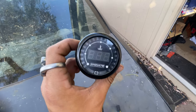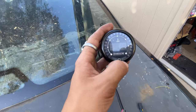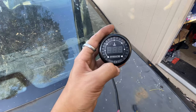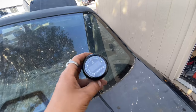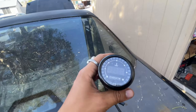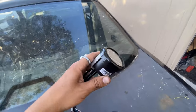So this is the gauge I'm working with — the Innovative coolant temperature and voltage gauge. The number gives you the temp in Fahrenheit, and this little bar gives you the voltage. You can actually program this gauge to give you different colors for different thresholds. There's also a red warning light you can program — you can set what temperature you want it to start flashing at to give you a warning.